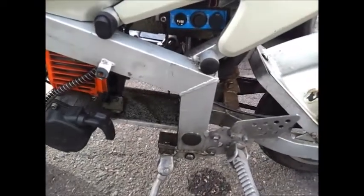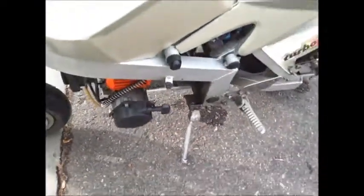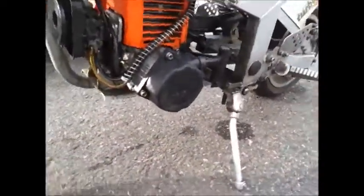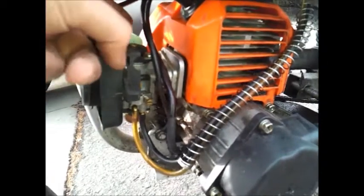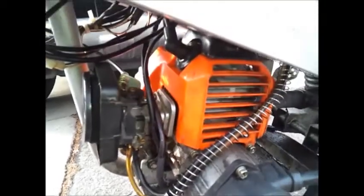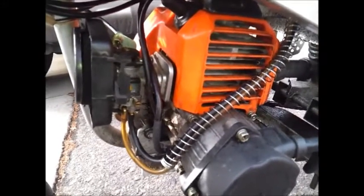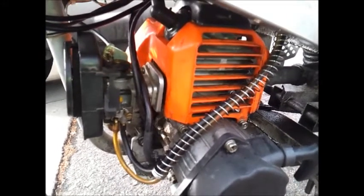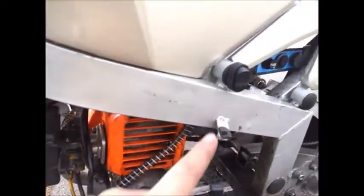Here's a lot of the stuff that I did to it — that was the most difficult part. I took the engine a little bit apart to get to the ignition coil, it's on the other side. Originally when it came it wasn't running, I was having some ignition coil problems. Basically the voltage regulator went out and that's what caused the problems, and that's why we need two switches now.